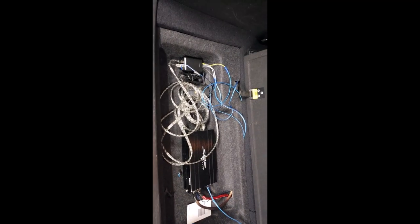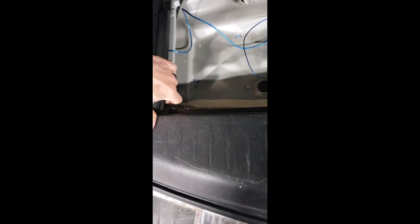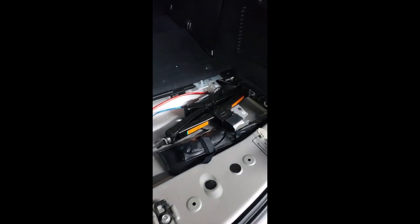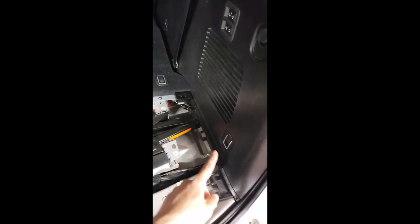You're going to take off this bottom trim piece all the way across - pull on it and it's going to pop straight out all the way. After you get that bottom piece off, you'll be able to take this panel off fully to get to the amp. You may not even have to take it all the way out - you might just lean it and be able to work on the amp. Make sure to take off all these pieces. You might be able to lean it over and get hooked up to the amp, which I'm going to show you with some pictures. I'm going to run the wire over the wheel well and down through a little hole right here so it's not going over stuff and can't get pinched.